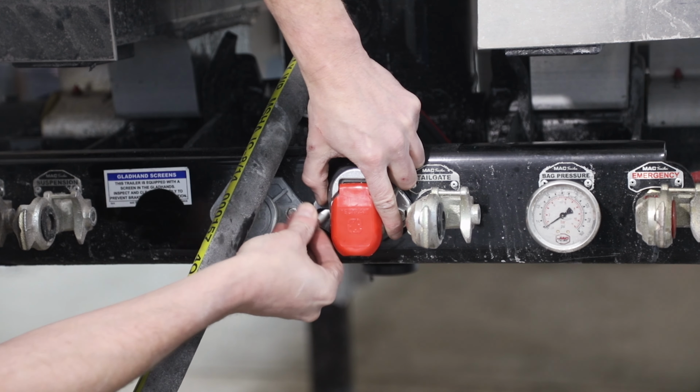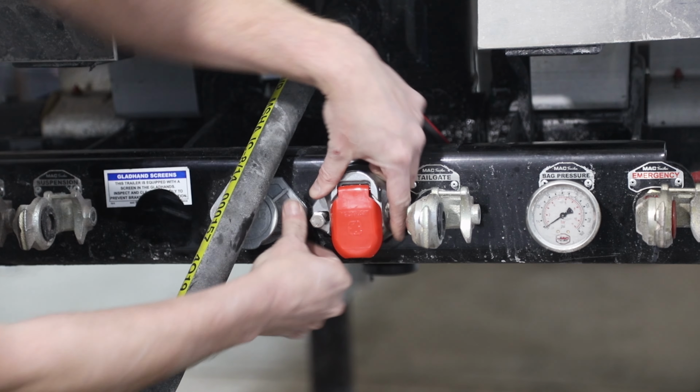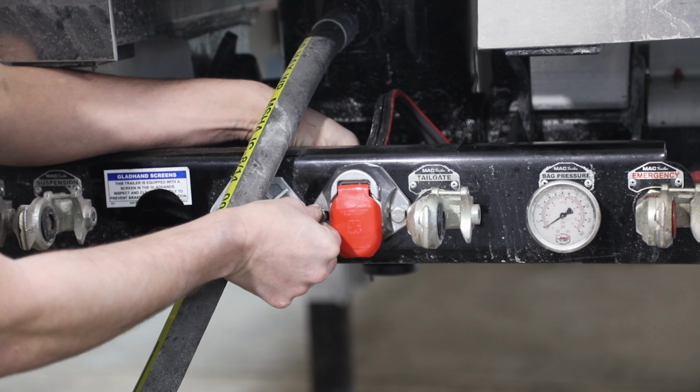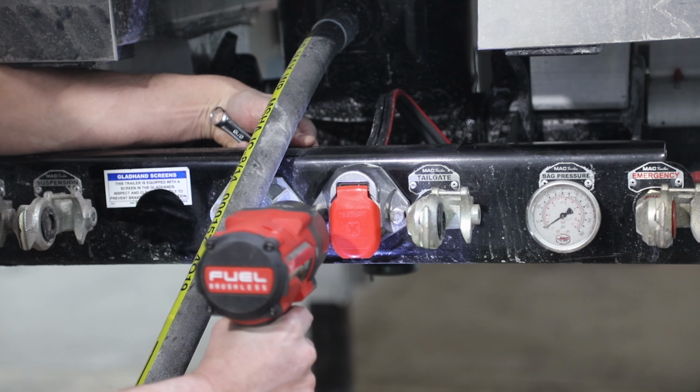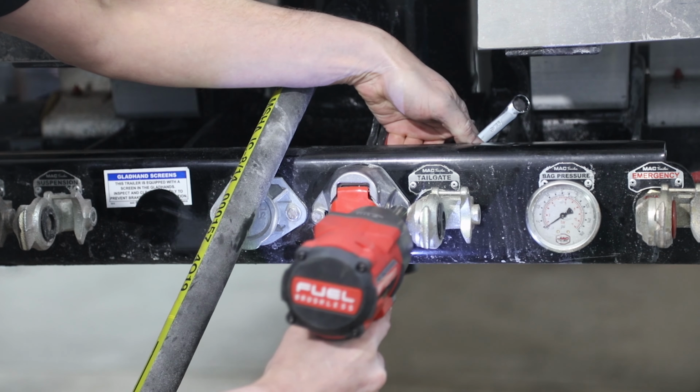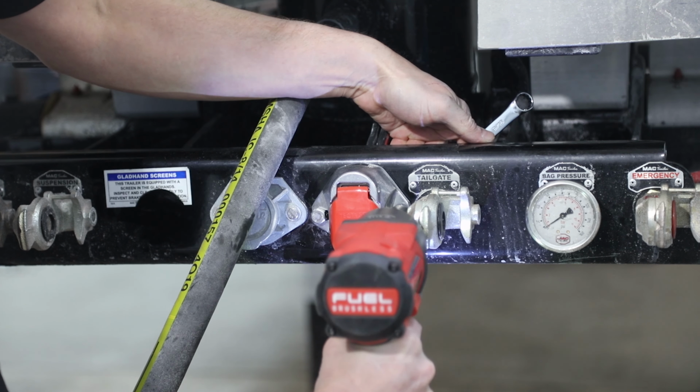Use holes in socket as template to drill holes at a suitable location in trailer wall adjacent to existing plug. Then secure with self-threading flange bolts, lock washers, flat washers, and nuts.